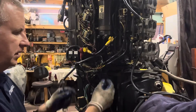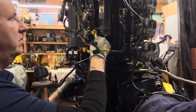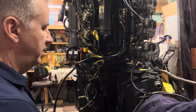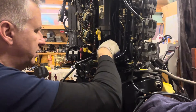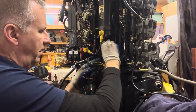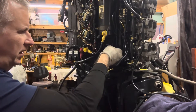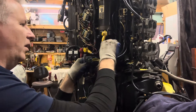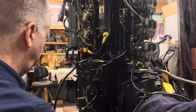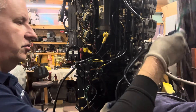We're going to keep a close look at all these wires and connections. We'll first take the obvious ones right where they go. We already have our battery cable hooked up, so we know this is for our starter. I see all my grounds here and I have the bolts for these grounds that all go together — I'm going to go ahead and get the bolt in there. I have another ground wire here that I'm assuming goes next to it, or it could go on the same bolt. We want to put it back the way it was. We also have our power tilt and trim relay.